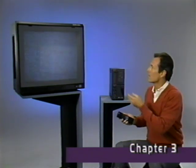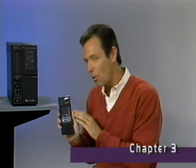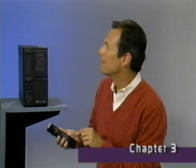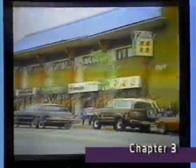If you don't get a picture and your TV screen looks like this, just press the TV video button once and you should get a picture immediately. The remote control can perform most VCR functions, including speed search forward, speed search reverse, and pause. To lock the speed search function so you don't have to hold the button down, just press it and release it immediately. To release the speed search lock, press play.